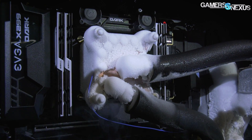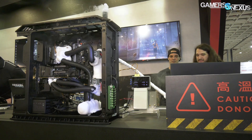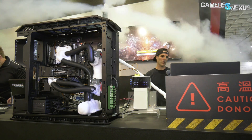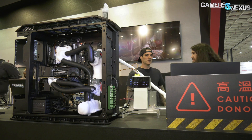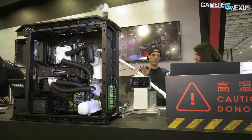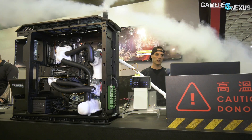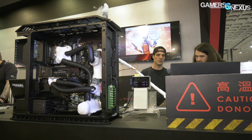So much ice — this looks fantastic. Imagine if you did a case mod with like an engine, with the pipes and all the exhaust — it would look so cool. So we've got Time Spy Extreme still running. I lowered the CPU to 5.5 and mesh at 37 because Time Spy Extreme is not so CPU-dependent — you can still get a great score with even 5 GHz. GPU offset is 213 MHz. Time Spy Extreme's AVX workload is really tough on the CPU, and it seems memory intensive as well.